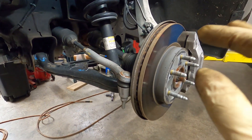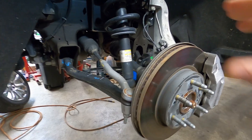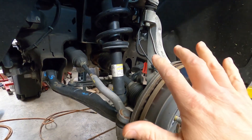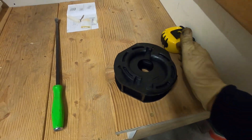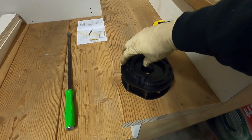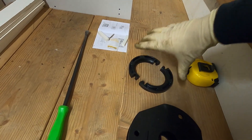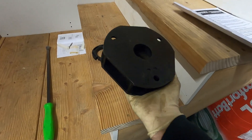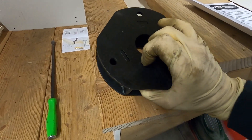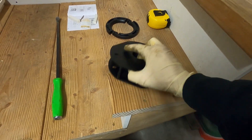The directions tell you to do a lot, including unplugging the rack and pinion, the differential, and unhooking all these sensors - but I don't think you need to go to that extreme. Here are the pieces going in: we have two split collar spacers that interlock and go underneath the spring, so you will need a spring compressor. And this is the spacer that goes on top of that strut assembly - you can see the three-bolt pattern for those studs to stick through.